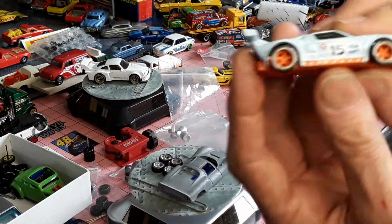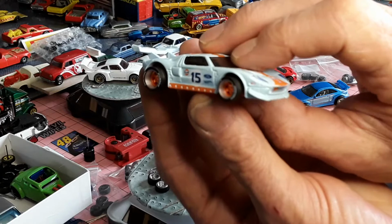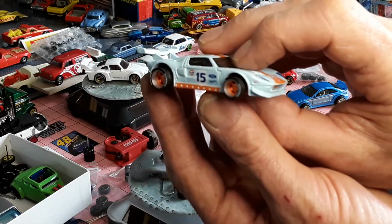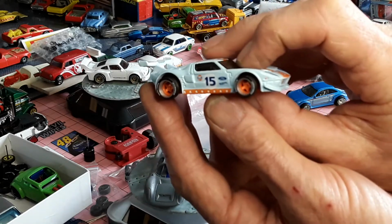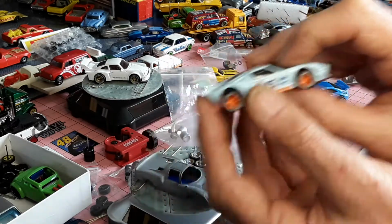there's the result there. Yeah, alloy rims. Now, with the alloy tube on the inside, it's not polished. So what I've chosen to do is I rolled up a bit of 800 wet and dry, and I ran it on the inside so it gives it that machined look finish.